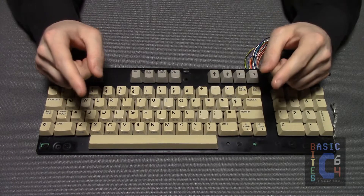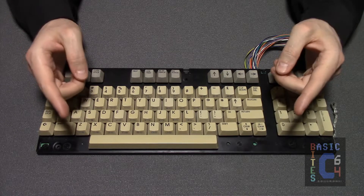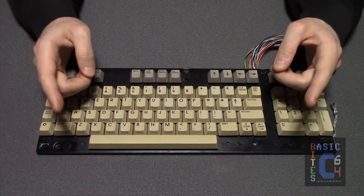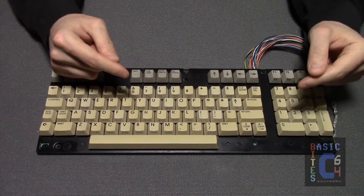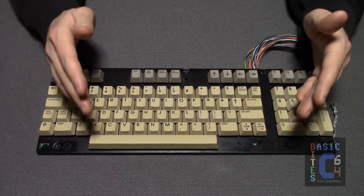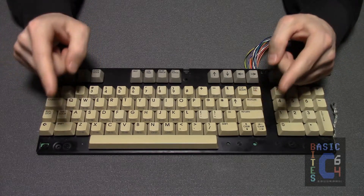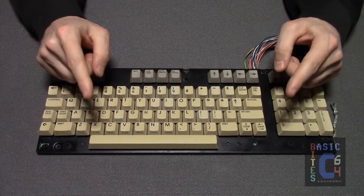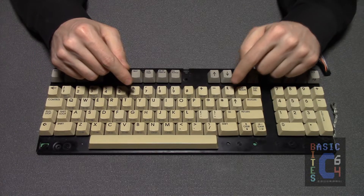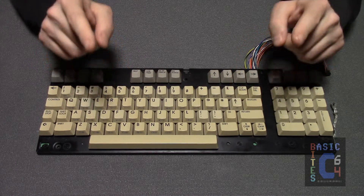As for me, now that I have a fully working keyboard, I can get to cleaning keycaps and springs — although I don't think that's exactly what is meant by spring cleaning. In any case, the F7 key is just fine now that it's unobstructed by a ground spring, and switching the plunger on the left shift key turned out to be the exact right call, because, all corny joking aside, the pound key now does take a bit more of a deliberate force to press.